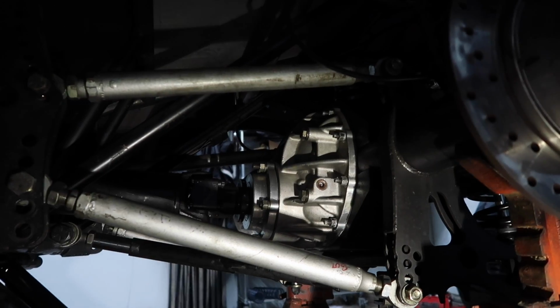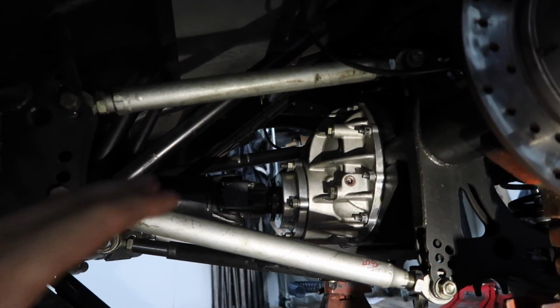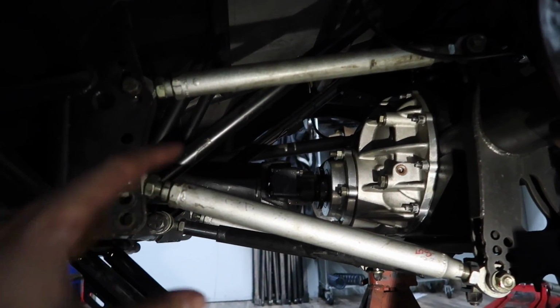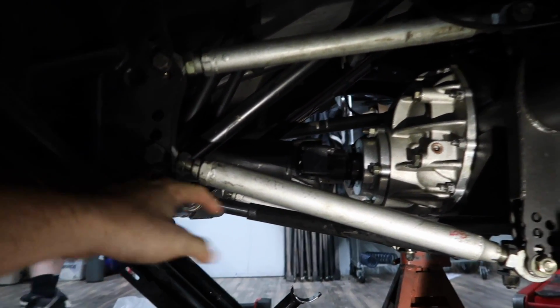We tried to just tighten up the shock more, but honestly, there's a million ways to skin a cat, and lately we have been running super sticky tracks, so we're going to drop this down, and we're going to take some anti-squat out of it, and we're going to run the shock a little bit looser. So we can do the same thing.